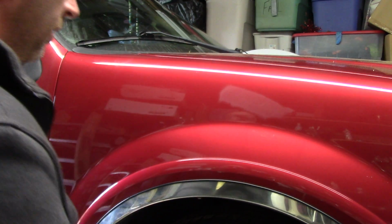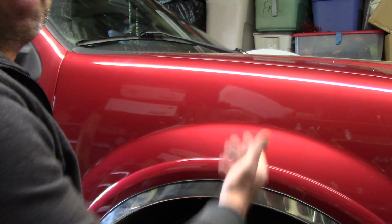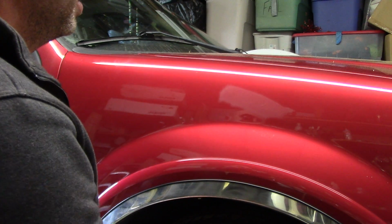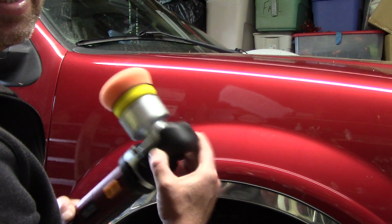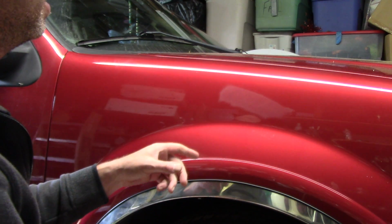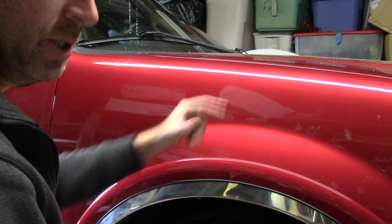The next thing I'm going to do, I've removed the fluid, looked at my scratch pattern. This is 2000 grit. Some people say, hey, why don't you back out slowly? Why don't you go to 2500? Why do you go to 3000 grit? Well, because I know I can remove 2000 grit sandpaper marks even with a cheap little DA and a medium cut polishing pad or compounding pad, however you want to look at it. So basically, I want to remove my scratch pattern. I want to restore shine and gloss, get rid of all that stuff.